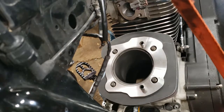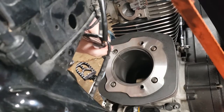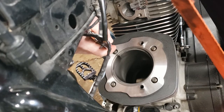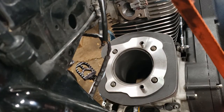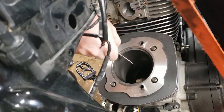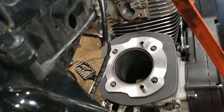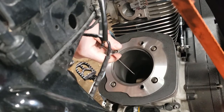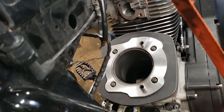It actually fits really well. I believe we can go up to 25 or 26 thousandths. Up to 21 on that, then up to 23 - 23 is a tad bit too tight, so we'll probably call it 22. We'll check this to make sure. 22 - definitely. So we're sitting really good on that ring.